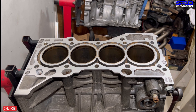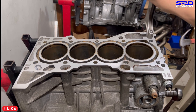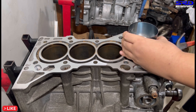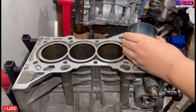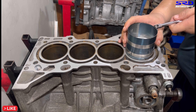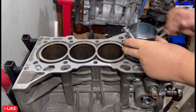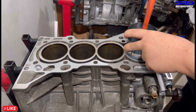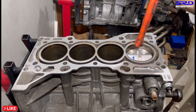Now time for business — let's start. Make sure the piston is aligned well, then tap it so it's perpendicular. You can tap it in safely. Once you have it flush on the deck you can tighten the ring compressor better. There you go.